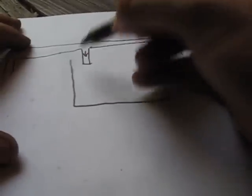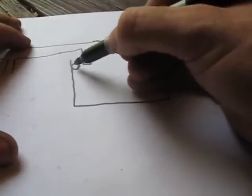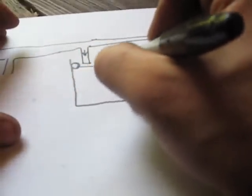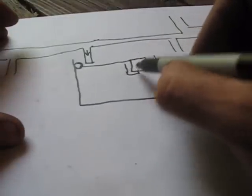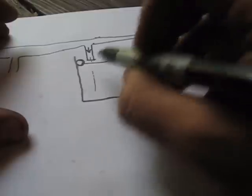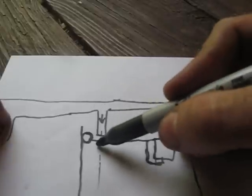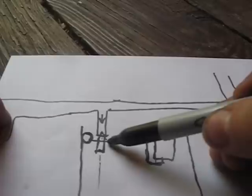Okay. So what we have here is a small hinge. Now you're looking at it sort of head on, right? And then that which pivots on this hinge is a float. Typically you'll have 2 floats. So you have 2 floats, right? And gas pours in through here. Okay? When the level rises, what comes up through here, let me bring it closer so you guys can see it, is a needle. It is sort of like a pyramid shaped thing that goes through here, and it's connected to the arm of the floats.